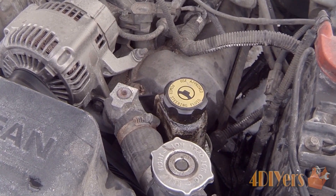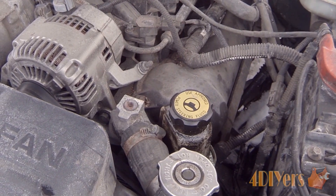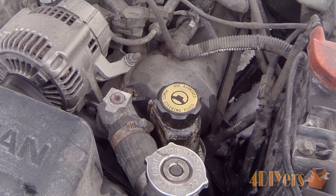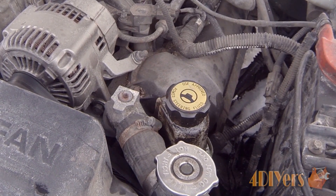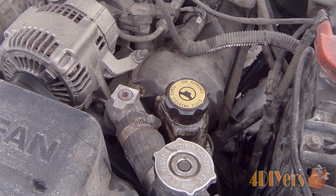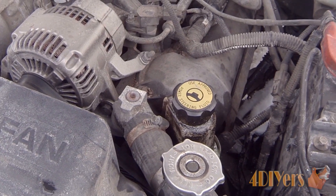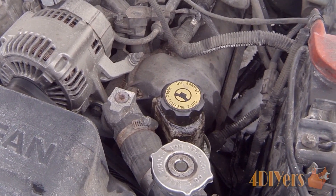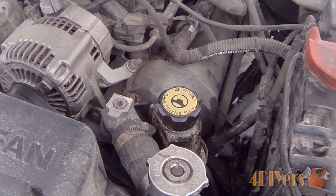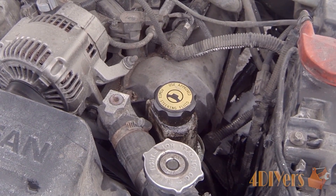Other issues: if your steering rack is acting up, the system can leak in various spots, so you will need to get underneath the vehicle and look at the steering rack and any of the lines. You can also inspect from the top and look for any buildup of residue. It can help to wash your engine down and clean up excess residue, then re-inspect for leaks. The internals can also fail inside the steering rack or steering box — you may notice that the steering turns one way harder than the other, or you may feel or hear a crunching noise. You can use a stethoscope on the vehicle while on a hoist and turn the wheel back and forth to listen for internal crunching of the gears, as they do wear out over time.